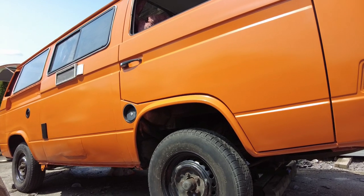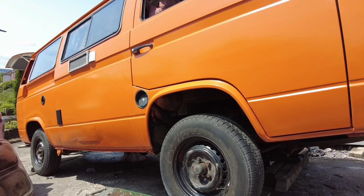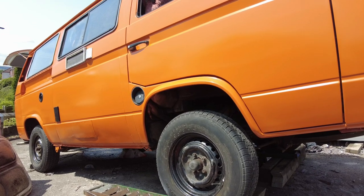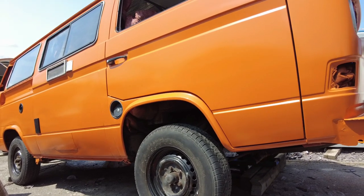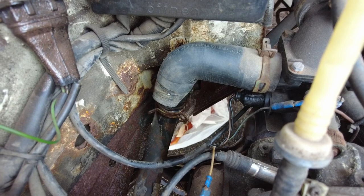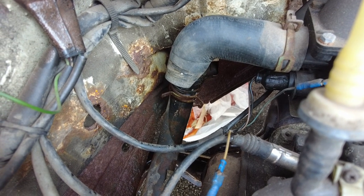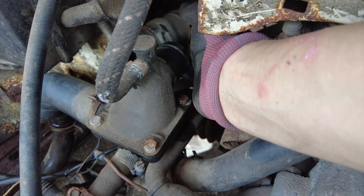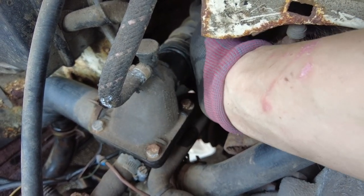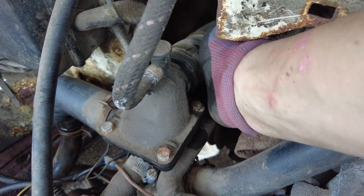If you have it level, I personally have never got one to bleed properly, so you just have to get the nose up as high as you can. On the old van I used to drive up a concrete ramp at the side of the road — that was properly aggressive, really high — and it always bled effectively when it was up like that. Yep, definitely water. So once I've got as much water out as possible, this bottom pipe's back on. It's all a little bit fiddly. If you guys know a better way of doing this I'd love to know — it's kind of the way I've always done it, but I'm not saying it's the right way.